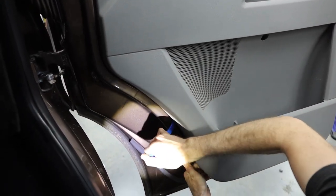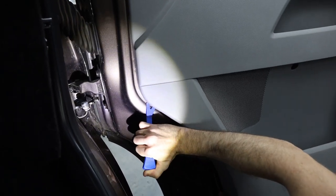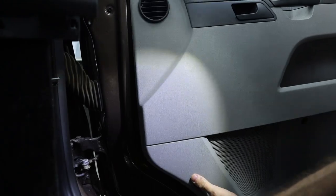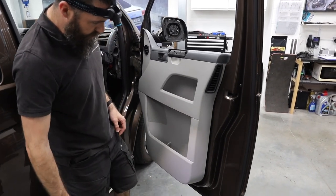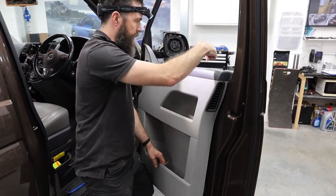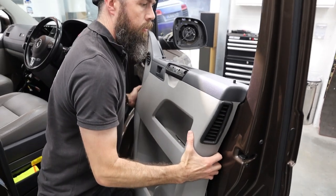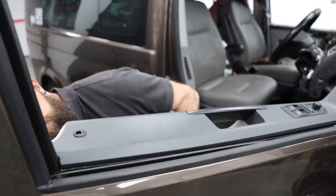The same process on the inner side of the door — you just can't see as much, but once you've got your hand in there you can use it as leverage to help the door card release. Step 10: you need to lift the bottom of the door card up and give it a little shunt with your hand because it sits over a top ledge of the window runner. That part looks stiff because it's part of the window rubber seal itself.